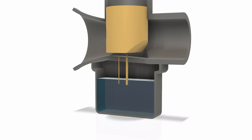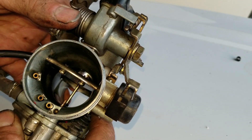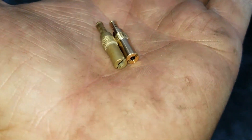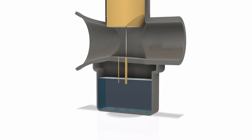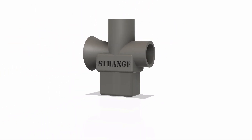As you crack the throttle, it opens up a valve and pulls a needle up through a jet, allowing more air and more fuel through simultaneously. When you rebuild a carburetor you replace old worn-out jets with new clean ones, so it made me nervous when I found out these jets were clean and working properly — meaning my fuel starvation problem wasn't related to them.